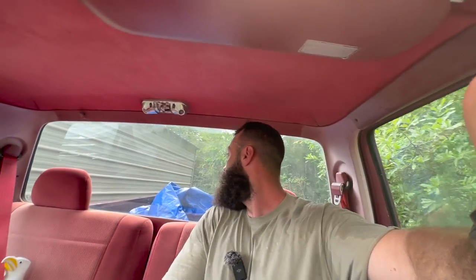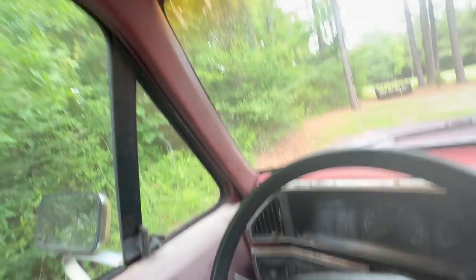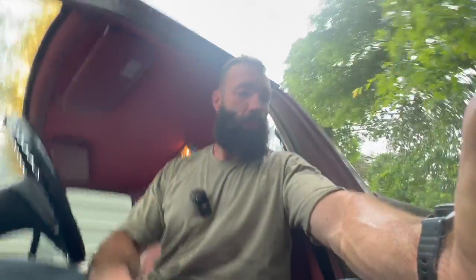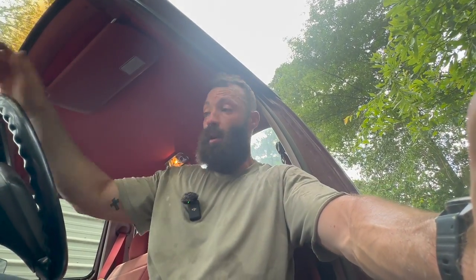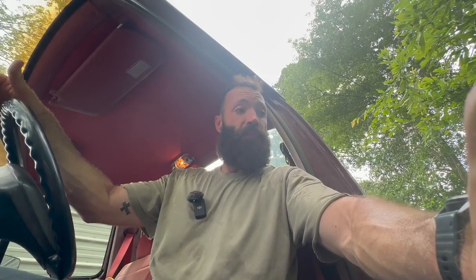This thing's going to sit here for a couple days. I hide her back here. I'm going to let all that sit in there and clean the injectors and the pump — the ATF fluid and the diesel clean ought to do wonders for it. It is way better than it was. I love this truck.